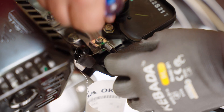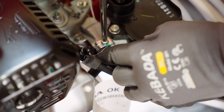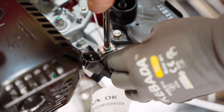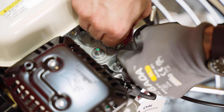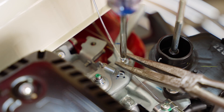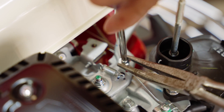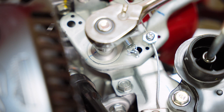Next, place the throttle lever into the run position, then loosen the cable housing clamp screw and the swivel stop screw with the Phillips head screwdriver. Feed the cable through the cable housing clamp and swivel stop hole until the cable housing extends under the housing clamp. Adjust the cable's tension as needed by loosening or tightening the swivel stop and cable retaining screw on the throttle lever.